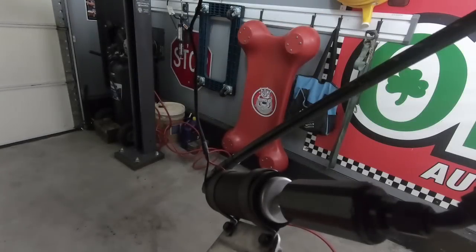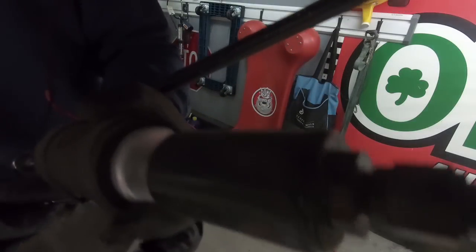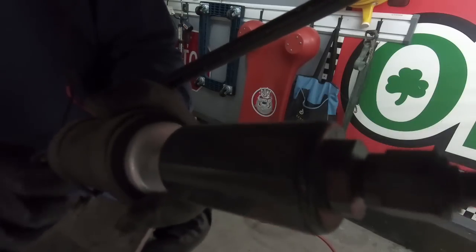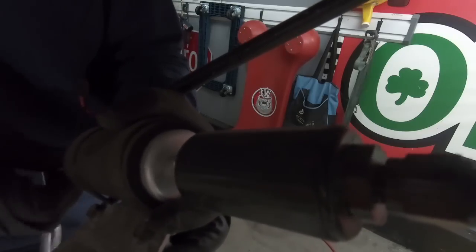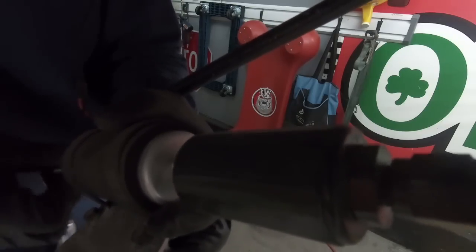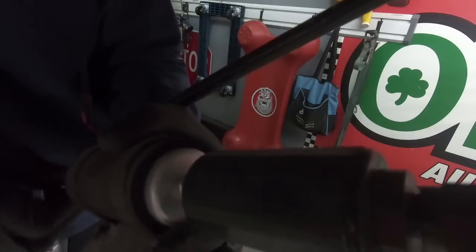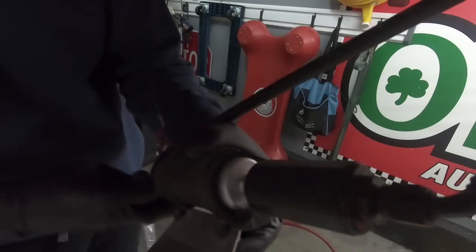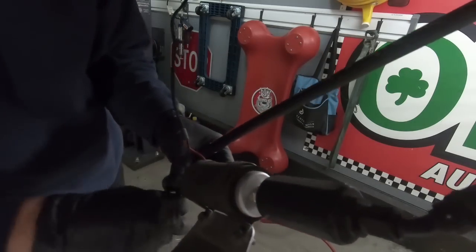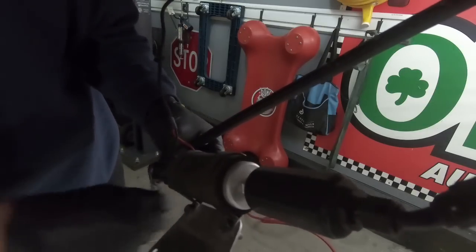Now that we have this whole fuel pump assembly down, I can go ahead and take the wires loose, just 8 millimeters. And then we get to do the fun part, guys, and that is unhooking this line, probably getting a bunch of fuel all over everything. So really not looking forward to that. And then the wiring will route out once we get it on the ground.